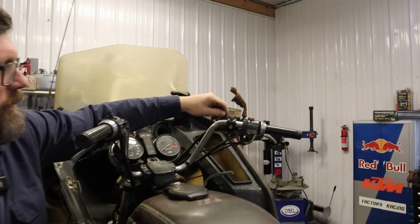So I think at least I know we don't have any sort of problem between the rear wheel through the transmission. It seems like our problem is either the engine's stuck, maybe a valve stuck. Let's pull this clutch cover next and see what we see in there. I'm getting some interesting smells. Can you describe them for us? Burnt.